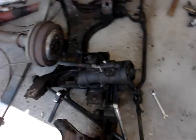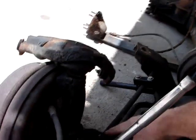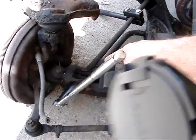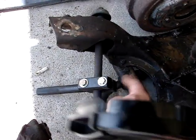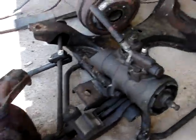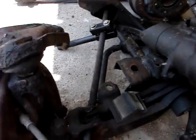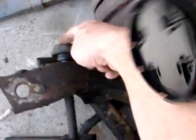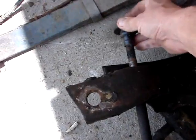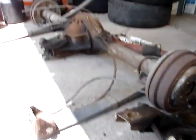For starters we've got to do what is called a strut rod. What I have here is a torsion bar removal tool — it's not that expensive, you can get them on eBay. I need to remove this: there's a nut here, then a nut in back which I already took off, and the bushing comes out of there. Those are the strut rod bushings. It isn't that hard once you break it loose, but you might need that tool because this will want to spin.